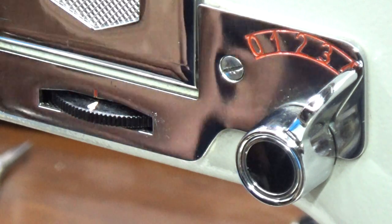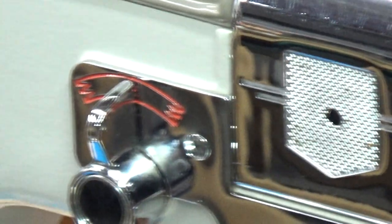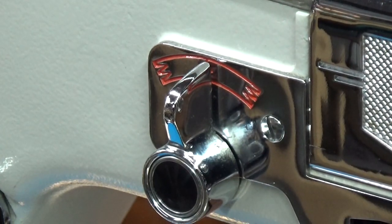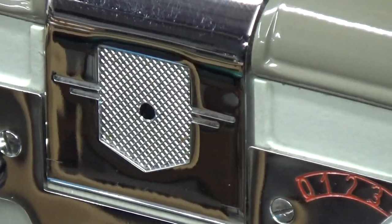For most of the sewing, unlike Debbie's Supernova, where I had pointed out that you have to either move it to left needle position, or the cam in some cases will move the needle position to the left, on this 339 it doesn't matter. You can do straight stitching, zigzag stitching, snaky type stitch sewing, which you'll eventually see what I mean by that, and you can do cam generated sewing with the needle position in center, right, or left. It really doesn't matter. So it gives you a little bit more flexibility.